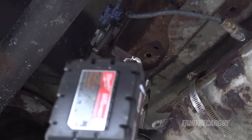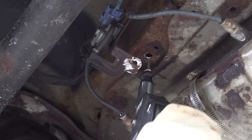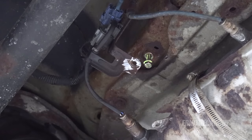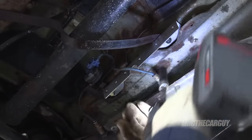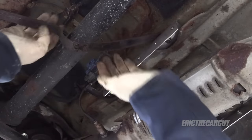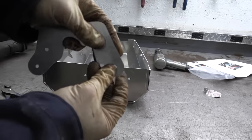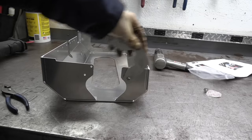I need to enlarge the hole slightly — I'm using a 21/64 drill bit here. With the rivet gun, we'll install the nutsert. This will allow me to take that fastener and screw it right in. With that sorted, I can install the other bracket. I'm going to reform that loop a little bit. Finally, the brackets are installed. Next step is to install this rear tab — I'm going to take one of the tamper-proof screws and one of the lock washers. They say to temporarily install it so you can rotate it up around the exhaust.